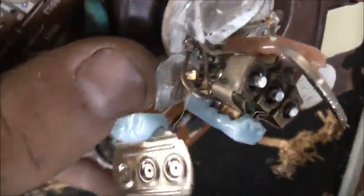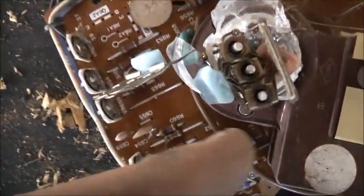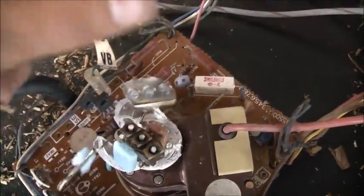Your 3 electron guns. So if even this was working, if this was still intact, the CRT would have been worn. Because my other AWA I got in there, it's got a pretty badly worn CRT. There's a lot of bleeding, so it's usually the cathodes that wear in here. You can see this has had a lot of use on it. A high hour set. The colour of that. Had a lot of use. Still would have been a nice TV there if it was intact.